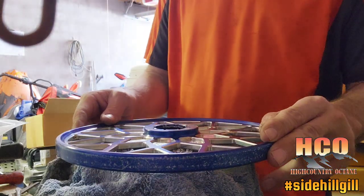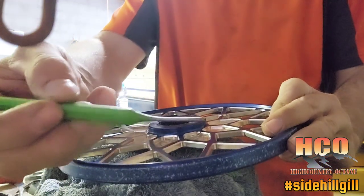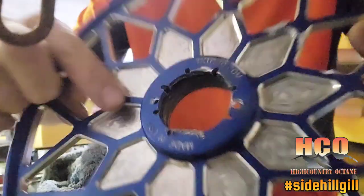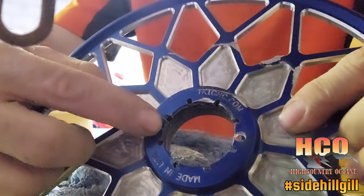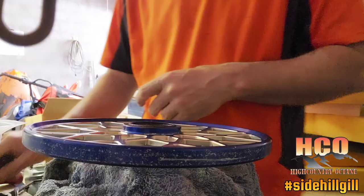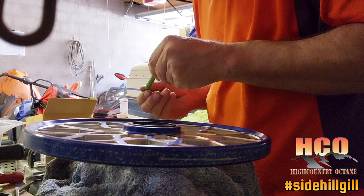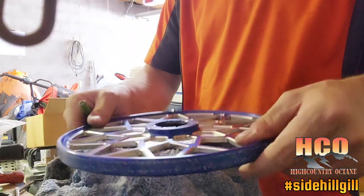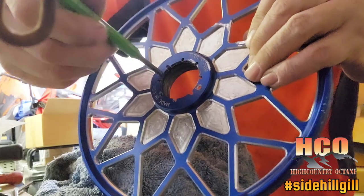So with that I moved on to step three. I tried using the small holes but the small center punch wasn't enough. What I ended up doing is drilling out my own holes - one there, one there - that went a little further into the hub, so I could get a center punch onto what's left of the bearing. I'm using a 13/64 drill bit and a 3/16 by 3/8 center punch. I piloted the holes first.